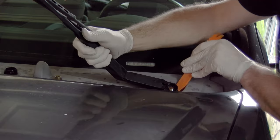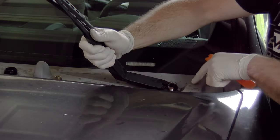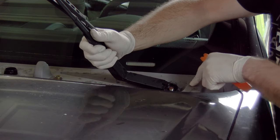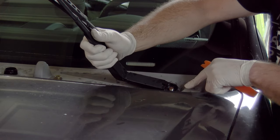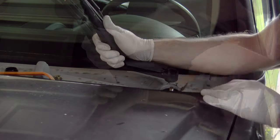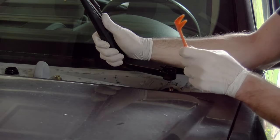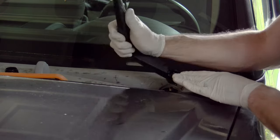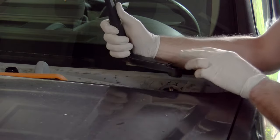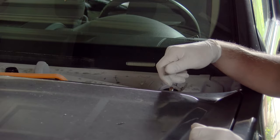It's still going to be kind of tight on that nut, but the motor is underneath and is mounted to the side of the car, probably to the firewall on the inside. So we want to be careful not to really rank on those mounts. I just gently pushed around it with my body clip remover and then rocked it back and forth by the joint and it came right off. Do the same with the other windshield wiper and then we can move on.